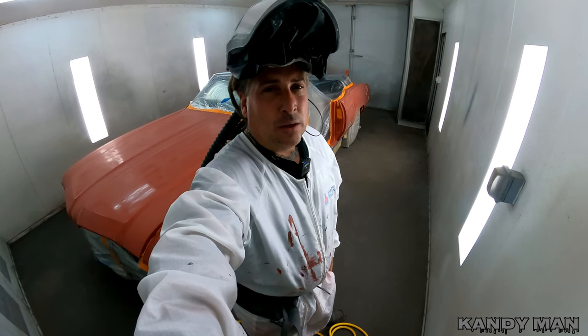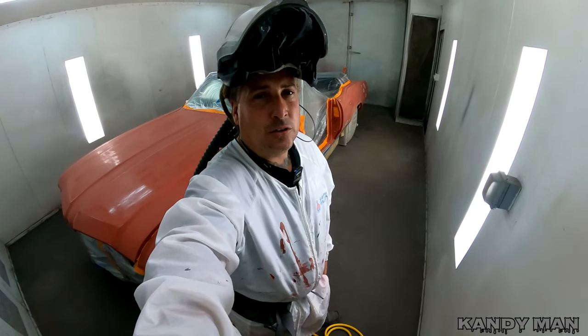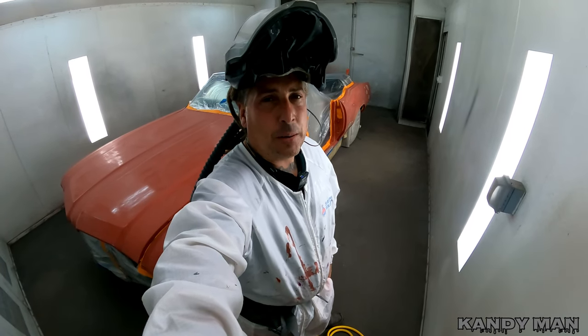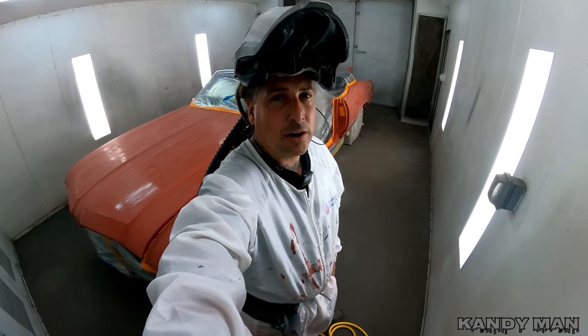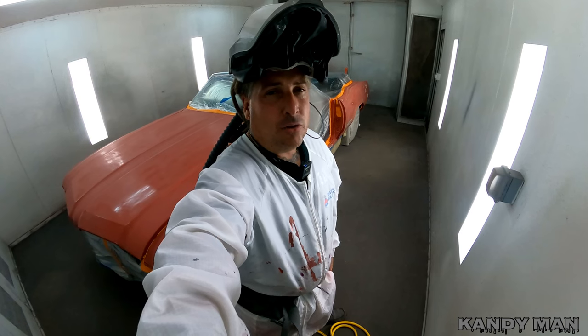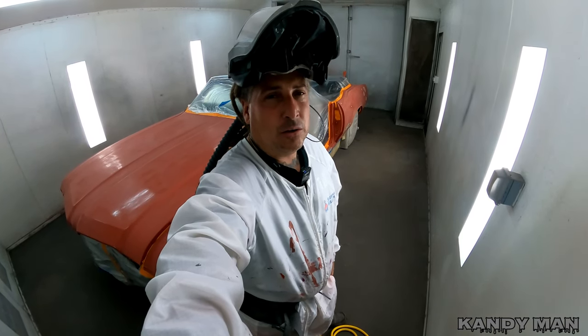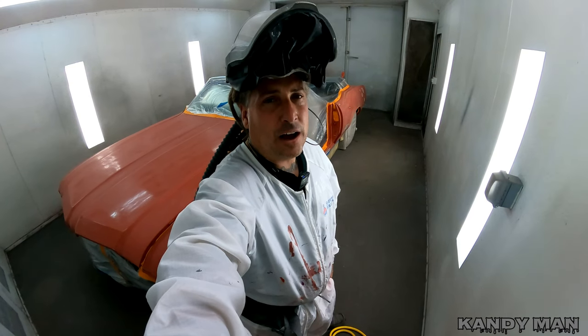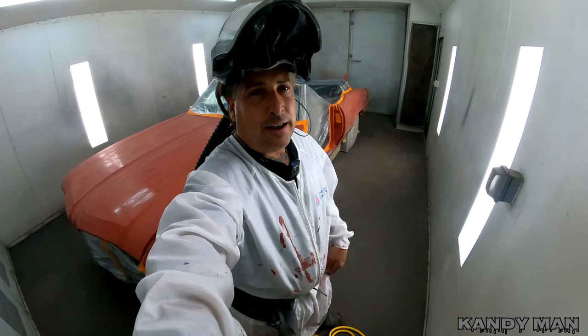So, you know, where we got to this stage, guys, I did it all at home like you would. So this is just because I don't want to overspray my garage. But if you were to build a little bit of a tent system, you could prime the car at your house. Just make sure that you have the proper dryer system or refrigerant or anything like that for the moisture, because I was telling you, it'll negate all the work you do on this job if you get moisture trapped under the paint and it'll try to come out later.